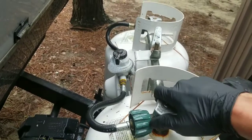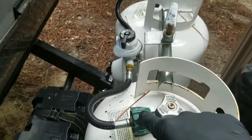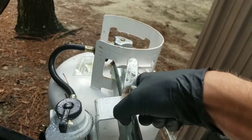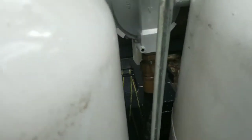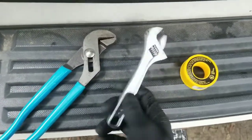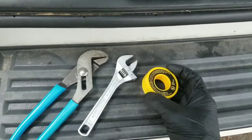The first thing I'm going to do is make sure both of my propane tanks are all the way closed. I'm going to have to disconnect these pigtail hoses from each one of the tanks, unscrew this piece up here which holds the regulator in place, and break one more gas connection down here on the backside. I'll use a pair of channel lock pliers, an adjustable wrench, and some Teflon tape for the threads on the hoses.